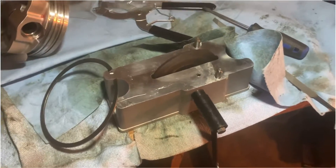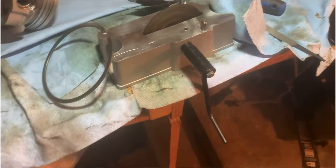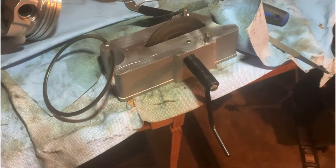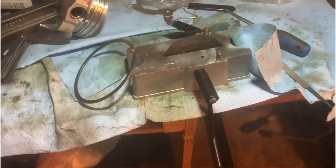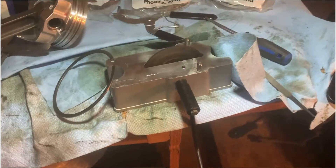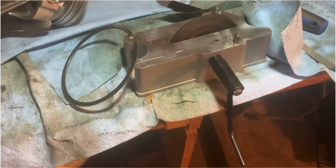I'm actually taking them out to 25–26 thou, which for me is still a little tidy. I've built straight-up drag nitrous motors before and I usually gapped them way out — like 30–32 thou — but I want to run this on the street too, and at lower RPM they'll puff oil. So I'm doing the middle-of-the-road thing. Some people do a larger gap on the top ring than the second ring, but I just do them the same — around 25–26 thou.